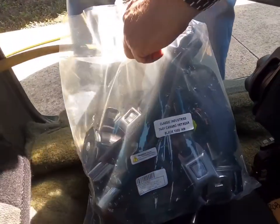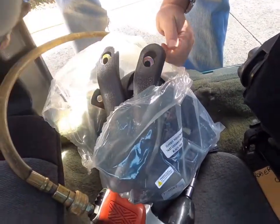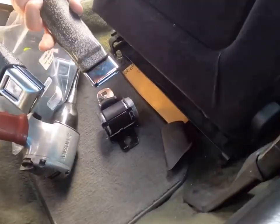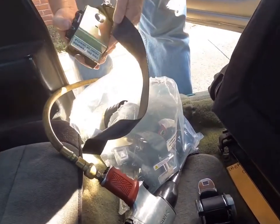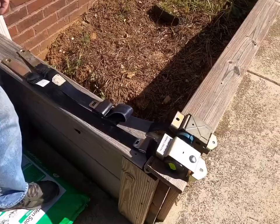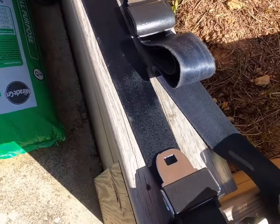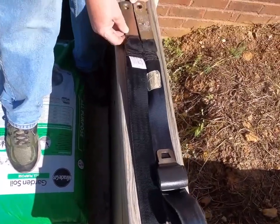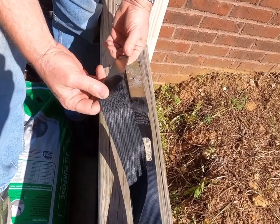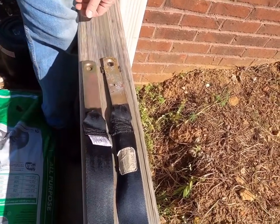I was tempted to use a knife to open this bag, but knowing me I'd end up cutting one of the belts. That's probably why they put that little spot there to tear it. I'm going to have to figure out which side is right and which is left. These are actually the rear ones. It'd be nice if they marked them right and left — it says 'this end towards front of the vehicle.' I just took one of them out of the bag. It looks like there's no driver or passenger side orientation other than how you put it in the car. They're marked as 'this end towards front of vehicle.' There's a hole underneath this piece of paper. So this is going to bolt in just like the old one came out. You can see these mounting brackets are the exact same length, and they're just going to go over like that in the vehicle. I just have to make sure I get the orientation right so the belt doesn't fold over when you lap your buckle up after the thing's installed.